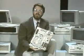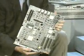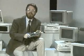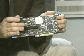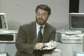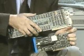The PS2s departed from the traditional PC architecture in that they used heavily integrated motherboards. This means that rather than having separate circuit boards to handle the functions of the video, hard and floppy disk controllers and the like, the PS2s pack most electronic functions onto the motherboard. The PS2 models use a completely different type of bus expansion slot from ISA. These slots are called micro-channel architecture, or MCA. Expansion boards for 8-bit or 16-bit ISA computers, you've seen this before, will not work in PS2 computers.